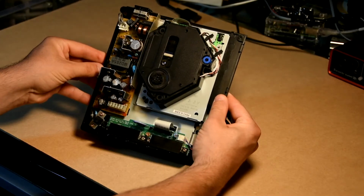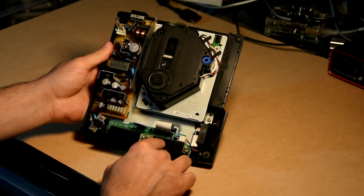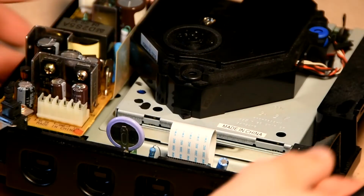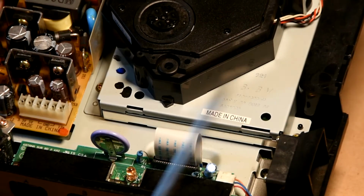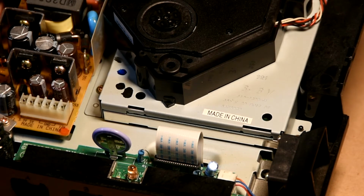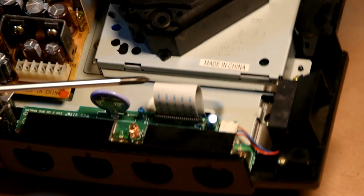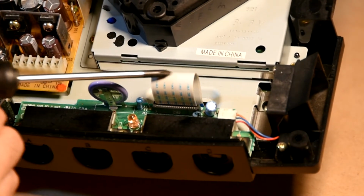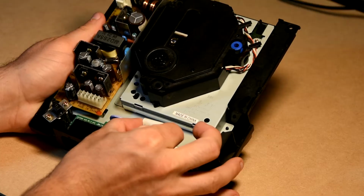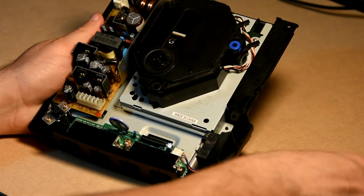Now locate the 4 screws securing the PCB board with the controller ports to the Dreamcast. Inside, you will see the permanently affixed internal safe battery as well as the stock orange LED light. Before you can remove the PCB board housing the controller ports, you must first disconnect the ribbon cable connecting the PCB board to the motherboard, as well as the power cable connecting to the fan.